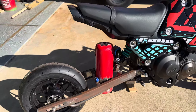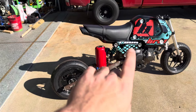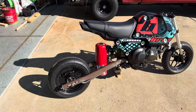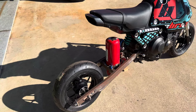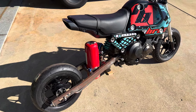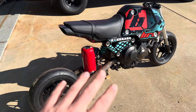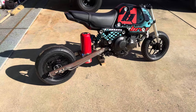I did this on the R7 swap Grom and it worked out really well. The only issue I had was the transfer line started leaking up in Tennessee when we were doing the Tail of the Dragon. I remedied that on the R7 build by switching to a stainless braided line, and we're going to skip straight to the stainless braided line on this build.